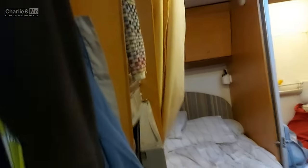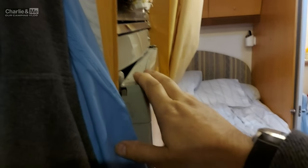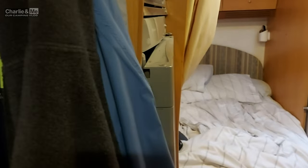Once that light is on, I have 220 volt power coming into the van. Apart from powering the sockets and the fridge when it's on 220 volt, it also powers a charger to keep your leisure battery charged. So you get to site, plug in your lead, the light comes on to let you know you've got power. If the light doesn't come on, go to where you're plugged in on site - most campsites have a little electric trip there. Flick up the trip if it's down and your power will come on. Some campsites only have a power socket on the pole and you may have to go to reception - they'll check your pitch number and flick up the trip in their fuse board.